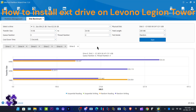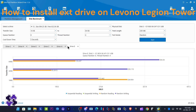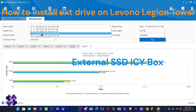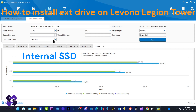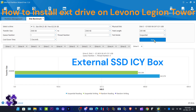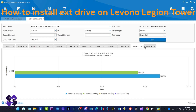I didn't quite understand the results at first — it's a bit confusing. In both the random and sequential tests, I didn't get a clear understanding of which is best. In some tests, the USB is better; in others, the internal is better. I tried increasing the transfer size to higher data. In this case, you can see the internal is slightly better for reading. They are very, very similar — around 500 MB/s — and the internal is just slightly better for writing.